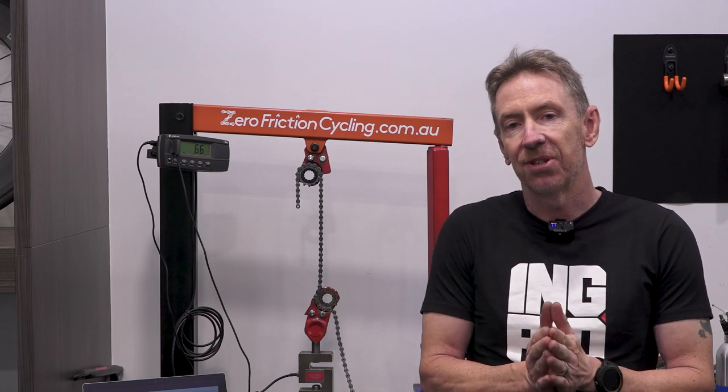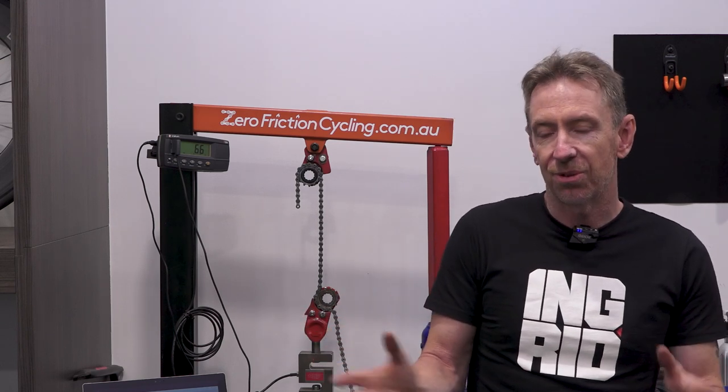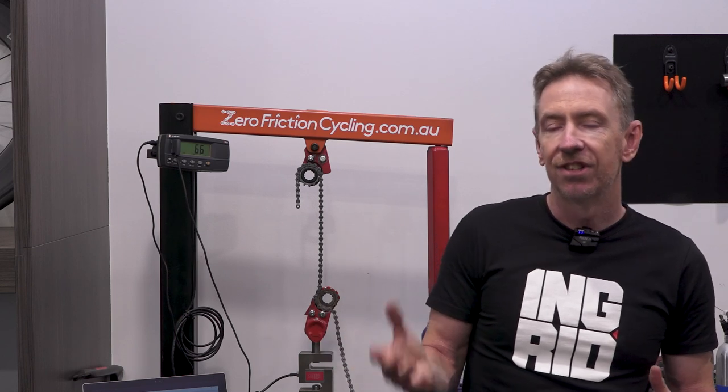One of the things we wanted to look at in this journey was, apart from the different speeds, are chains stronger at 8 speed because they're thicker versus, say, an 11 or 12 speed? The answer to that is no, not in a straight line test. They're basically all coming out somewhere over that 8,000 range. Most of the chains tested are coming out somewhere between about 8,800 newtons and about 9,200 newtons.